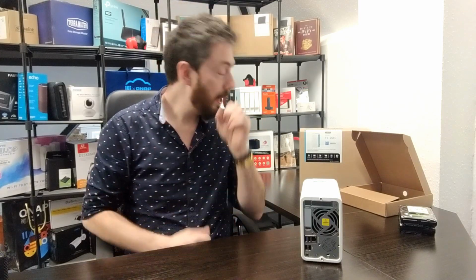But on top of that, you can use that internal SSD for raw storage. If you're a photo or video editor and you want to connect directly to the NAS to edit videos and raw photos, it is possible. You just put that 10 GbE card in there, have a 10 GbE port or a Thunderbolt to 10 GbE adapter on your PC or Mac system, and boom, you're now editing on the NAS, with the added benefit that the device can be connected to a standard network at the same time, allowing connected users over the network and the internet to use the device exactly at the same time and access your files.